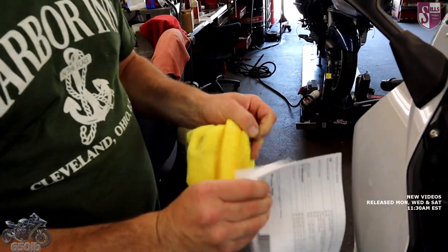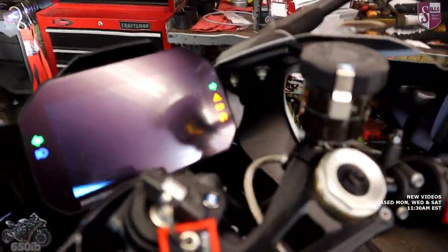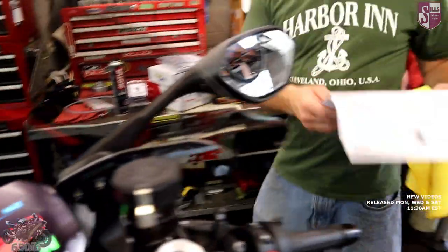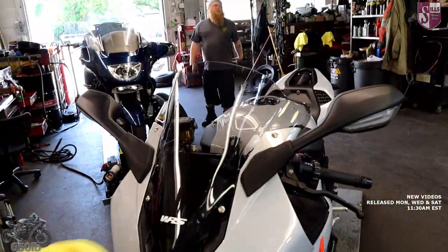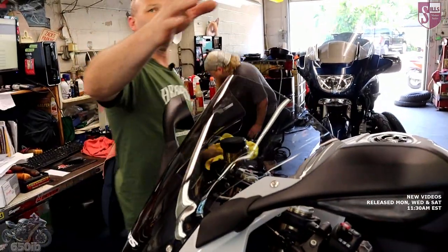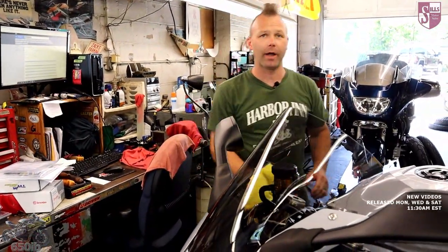We ended up with 429 miles, so we got the official running-in check and stamp. We removed the engine rev limiter so now you get the full motorcycle - that thing's super annoying. Pretty much just an oil change, a bunch of checks, and clean the chain, but that's all getting replaced anyway. We also installed a WRS tinted taller windscreen - it really makes the bike look nice and gives good protection. It has the double bubble shape so it should create a bigger wind tunnel effect over you so your helmet's not buffeting.